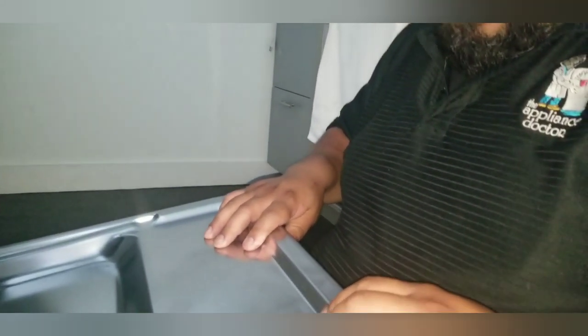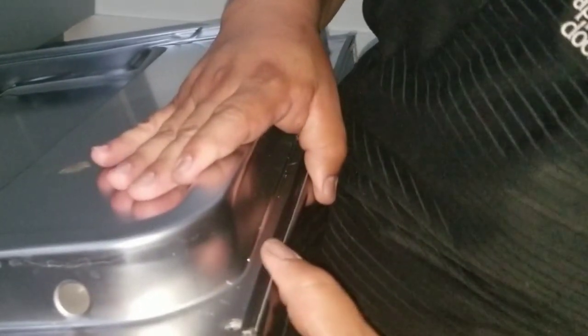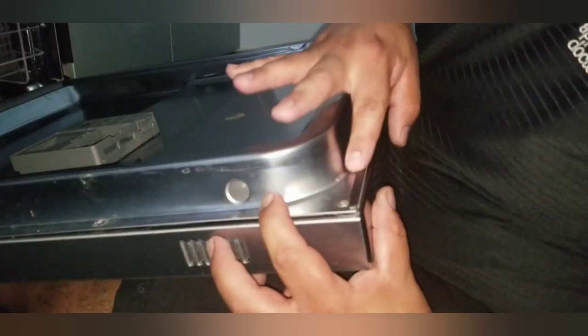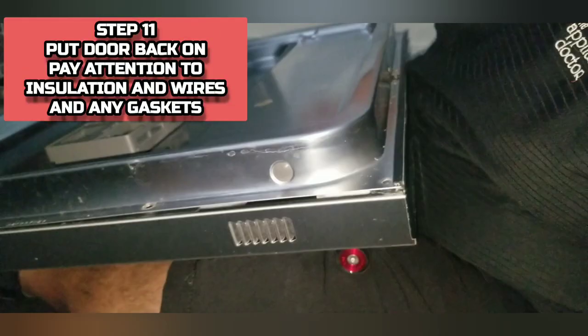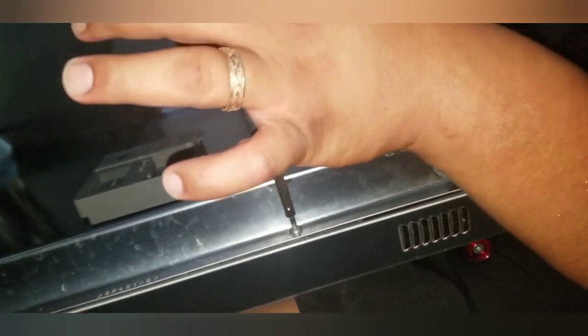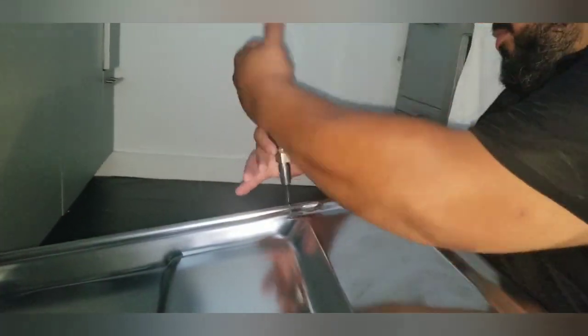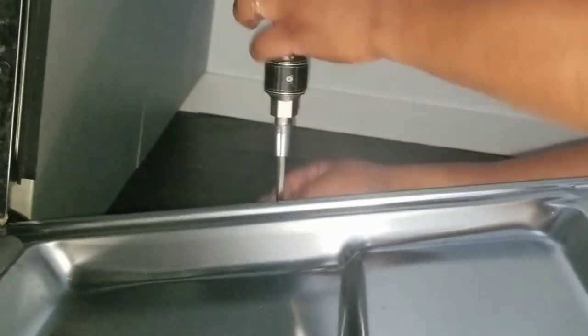Once everything's plugged in, you're going to shut that door together. A lot of doors slide on — they push forward, so you have to find the right way to do it. This one has what I call a wiper, like a little gasket that goes along the top of the door and the computer touchpad. That wiper has to sit on top of the door so water doesn't get into your components and wires. It's easier at this point to open the door slightly, sit on the floor, get that door on nice and snug, then start working your way around with screws gently. Don't tighten them all the way — once a screw has a little tension, leave it and put another one in. Use a crisscross pattern to get it in evenly, then work your way around one at a time. Don't forget there were two different sizes of screws: one long screw that only goes into plastic, and shorter screws that go metal to metal.